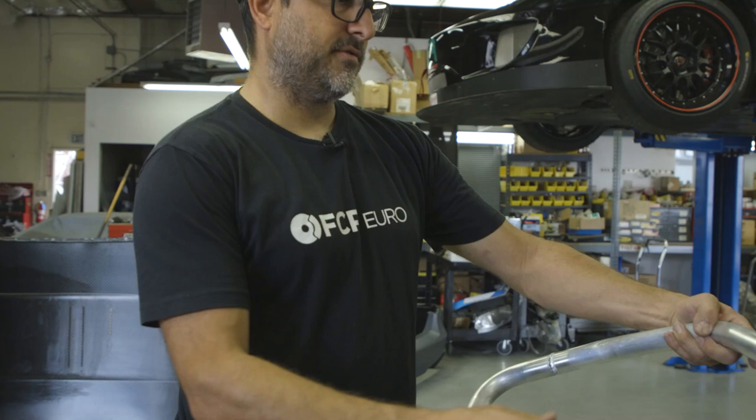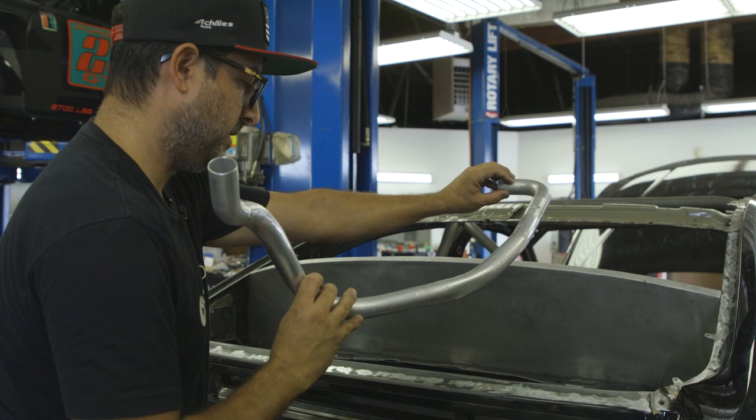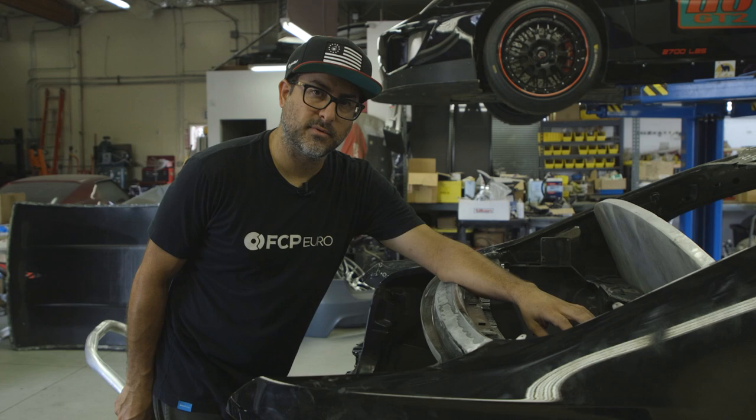Basically go into the car in the bottom like this. And then we'll have another tube that gets welded on, or maybe even just a hose coupler here. So the dash 20 side is gonna be like half hard line, and that was just the best way to do it. Instead of running a soft line all the way back here to the pump, it's pretty tight right there. There wasn't enough room for a fitting to get into that spot, so we bent up some aluminum tubing.